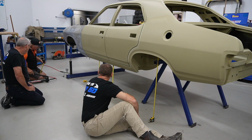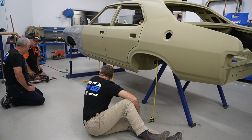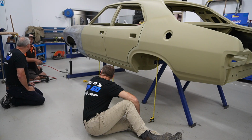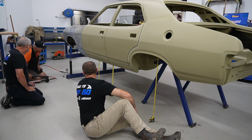Alright, we'll start at 250 psi. We're going to target to go to 1,000, which would be the equivalent of 6,000 Newton metres by the area of the cylinder and that pressure. But if we're looking good, I'm going to keep going and test the car to its max. Alright, if we don't break it, we're good. Here we go.